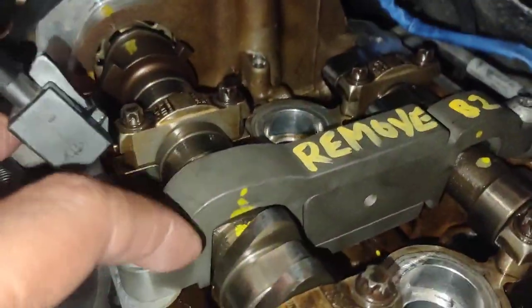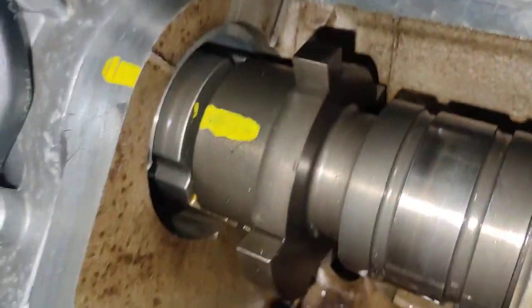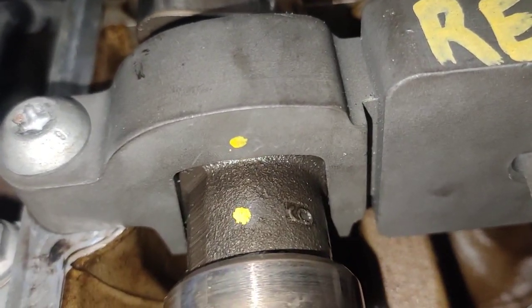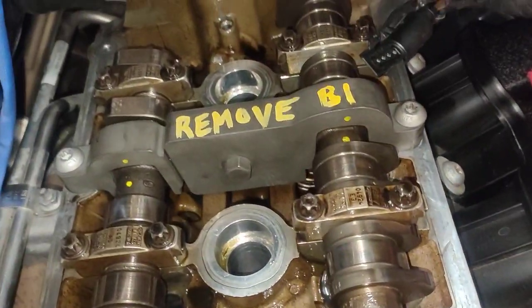Bank tool is done already, as you can see. See the marking before I took the camshaft out? The marking still lines up. The marking at the back there lines up. I've got the two dots aligned up. I always do that so at least you can see where the camshaft is, so you can't make a mistake.